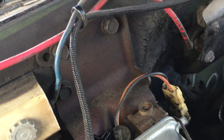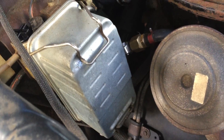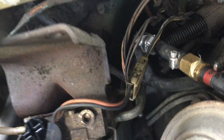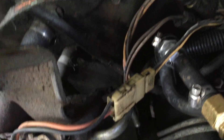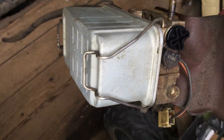There's a close-up view. Going to take these three bolts out — just 9/16". Get a little 9/16" ratchet and pop those right out. I'm going to take the whole thing off before I disconnect it — you don't need to pop that filter off first either; it's just going to dump fuel everywhere and there's no way to really stop it. With that pulled down and unscrewed, you can see the three connections you've got to pull right there — two black disconnectors and one white one. Pull them apart.